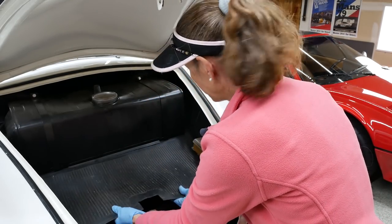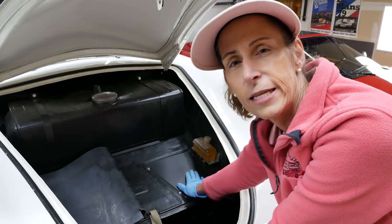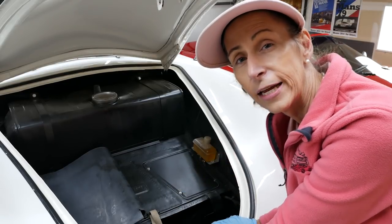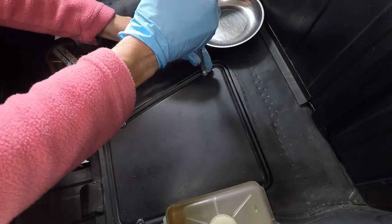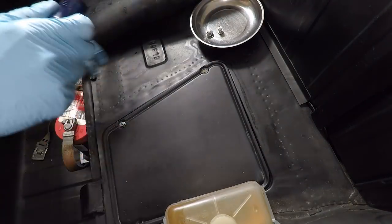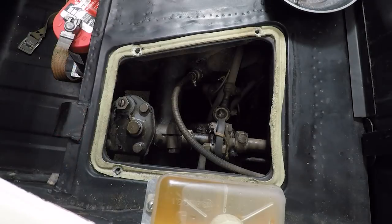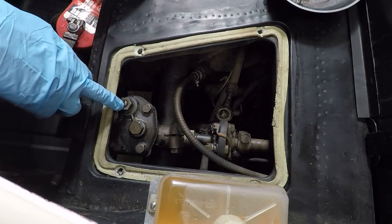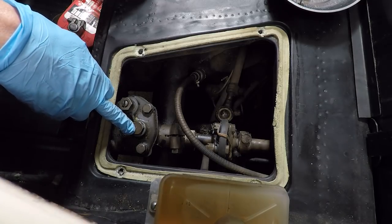All we have to do is pull up our rubber mat here and fold it over. We're getting into this trapezoidal box — there are four screws around here, we're going to take this off and get to the steering box. Let's remove this cover. So this is our steering box. That's the adjustment for the center, and this is the fill — that's what we're going to get at to put some grease in.